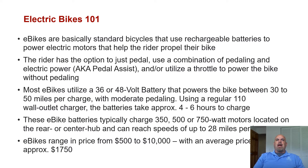Most of the bikes utilize either a 36 or 48-volt battery, and those will get you between 30 to 50 miles on a charge with moderate pedaling, but that is dependent upon the motor as well, among some other factors. These motors are typically 350-watt, 500, and 750-watt motors, which is really more about the speed. As they work in conjunction together, the distance and the speed do moderately affect how the bikes work, in addition to the weight of the bike, the weight of the rider, the incline or decline you're riding on, as well as wind.